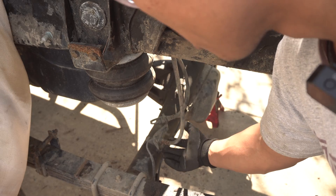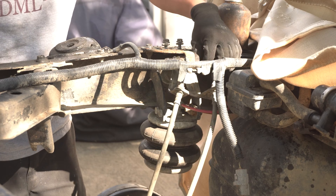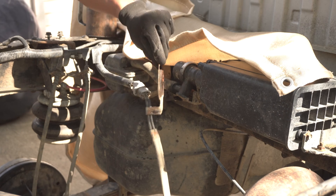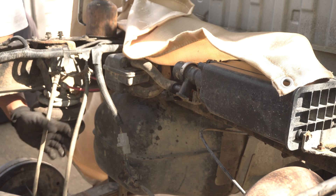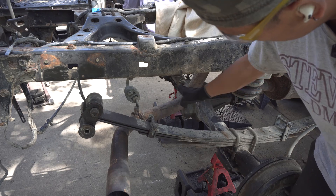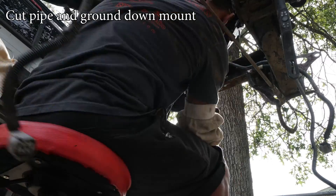I took this lower brake line bracket off of the bracket on the axle housing, so this is basically lifted up. This brake line bracket was also removed and loosened from the top, and this harness — I believe this is for the ABS — was on this bracket here, and I took that out too and just have it dangling. This allows us to at least not overtax the brake lines or any of these electronic cables. Number two, the end of that tailpipe is also in the way, and usually for that mod it would require a cut all the way back so that the tailpipe doesn't interfere with the leaf spring on the way down.